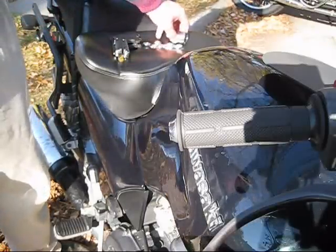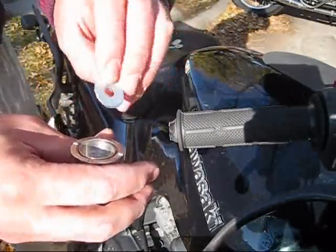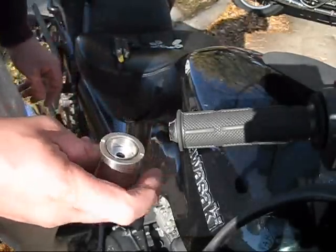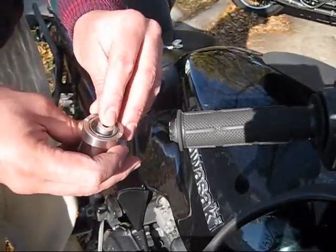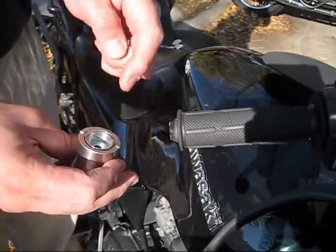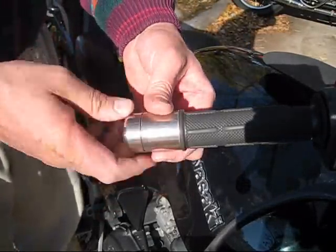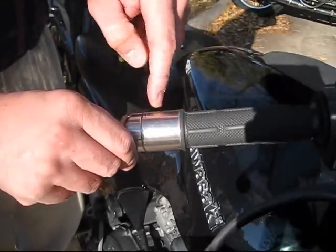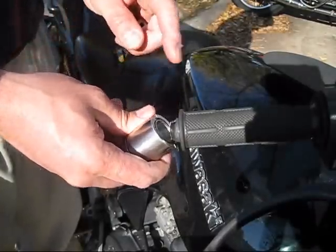So here's what happens next. You take your throttle lock — the manual will say to put a certain number of shims into it, and you just stuff them right in there. Then you put the nose on top of that. Like I said, I don't have a nose, but on some bikes it'll look like this, or there'll be some other shape of thing you put on top which is made to interface with the handlebar. So with the shims and the nose on top, you then press it against the bar. What you're looking for is a small clearance between the grip and the throttle lock. This obviously has no clearance, so that's no good at all — you'll have to add a shim.